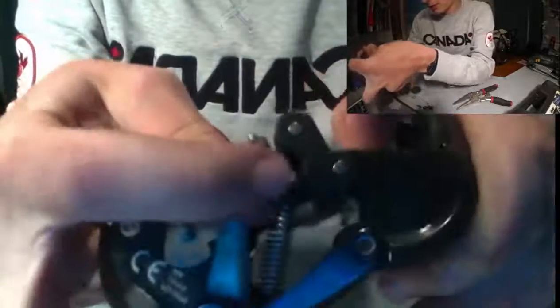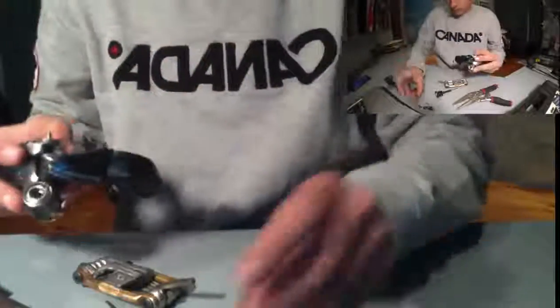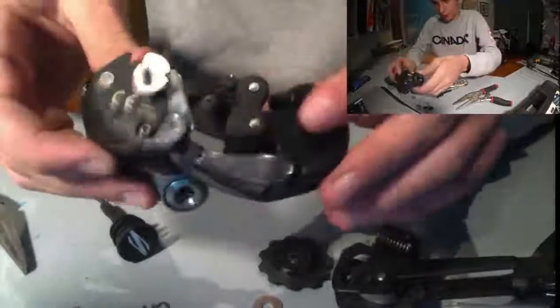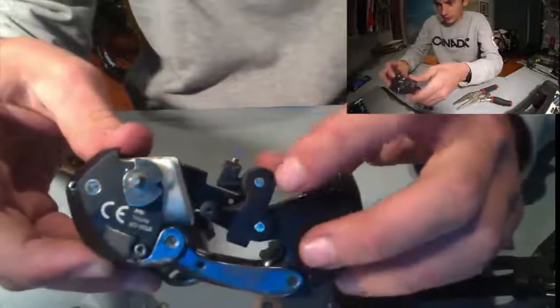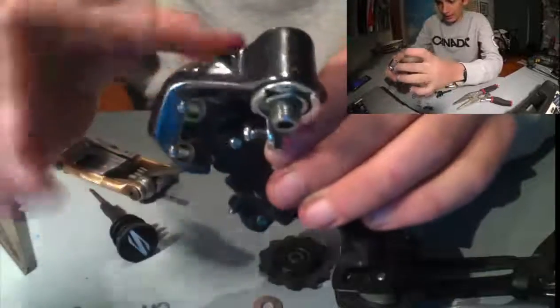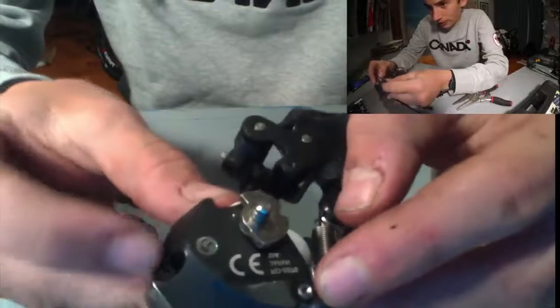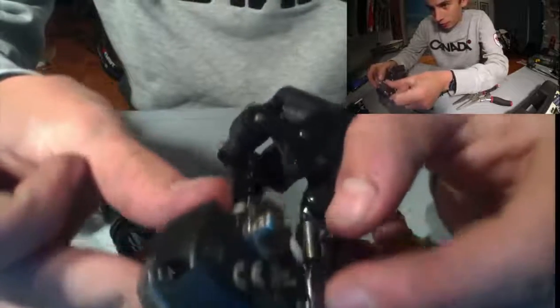So to remove that spring there's a little silver screw in there that needs to be removed. I'm going to go ahead and do that now. The derailleur is pretty much at the point where nothing else can be torn off it because there are no actual screws for these plates — they're just plates, so there's no way they can be removed. But to get into the housing there are two screws — you've got one there and one there — and I'm going to go ahead and try to open those ones up now.